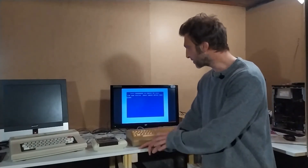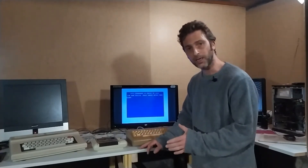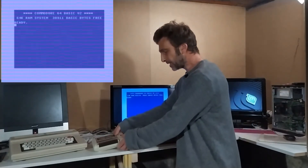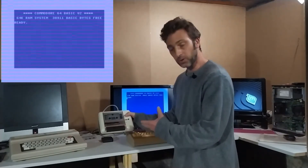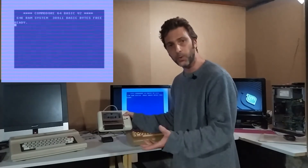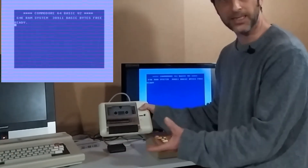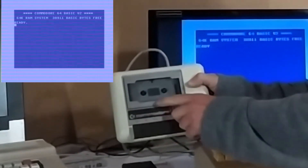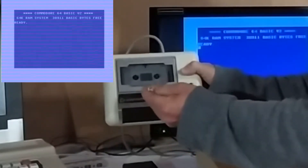Okay, I'm back out here in front of the Commodore 64, connected to the TV using RF because that leaves the composite connection available for my capture card. The datasette is connected to the Commodore 64 in the usual way. Now about adjusting the azimuth — you don't actually have to take the datasette apart at all. You'll see that just over the second 'M' in the Commodore logo there's a little hole, and this little hole allows you to insert a PH double-zero screwdriver to adjust that azimuth screw.